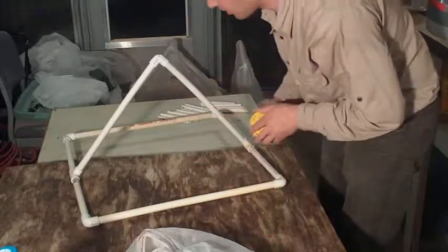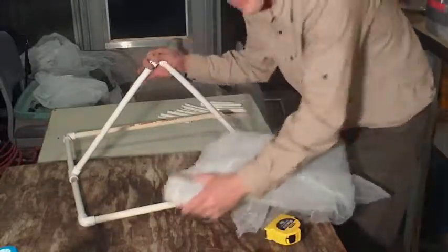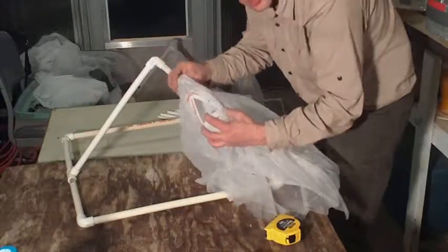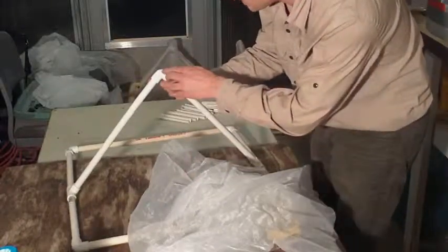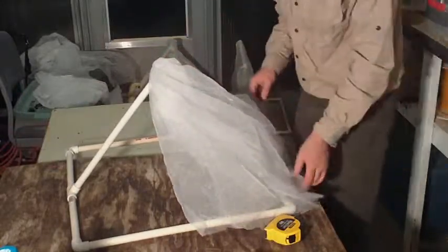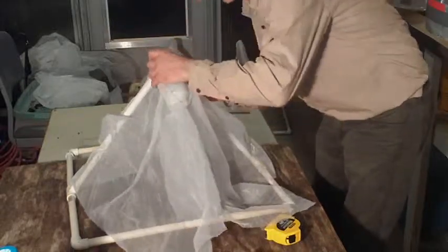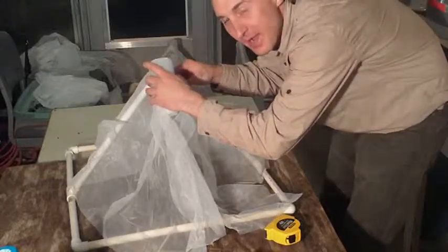I got to run out to the boat shed to get an original one. When I developed these, I really didn't like fabric alone holding up the bottle, because sometimes you've got a lot of ethanol in there. So I have a hole here in the top component — it's just an elbow at the top — and I drilled a hole in that. The rivet slides right into it. You might want to trim a centimeter off that rivet; you don't have to. You can also poke another hole in the back of the upper elbow, because that rivet's pretty long depending on the brand you buy.